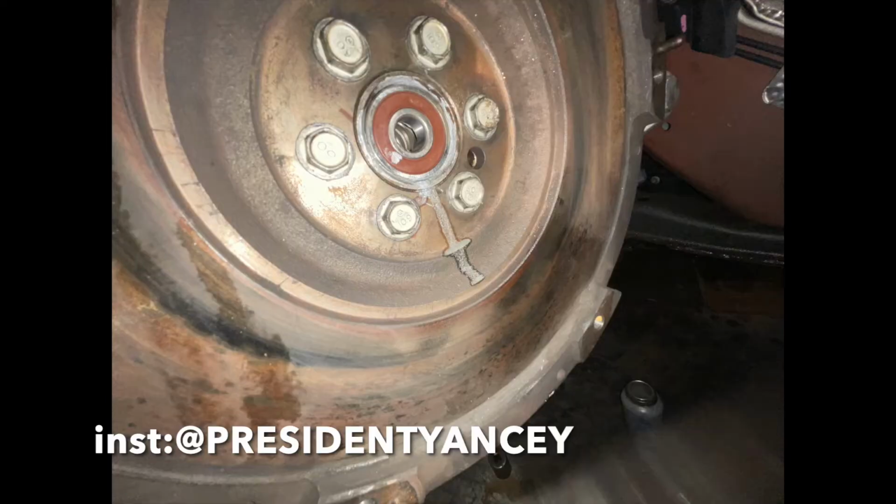Clutch. I made this one a topic on its own. You can use whatever clutch you want as long as it works for an LS3, LS2 Camaro clutch. So pretty much any 5th gen Camaro clutch would work. I went with the stock clutch for now, just to get the swap done, because my time and my resources are very thin with how I work. So I went with a stock 5th gen Camaro clutch and it works. The whole car moves, everything moves like it should.